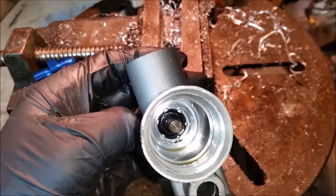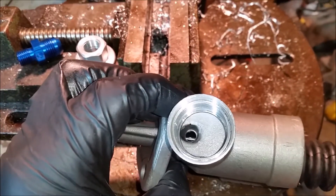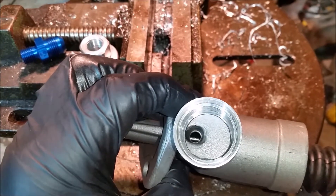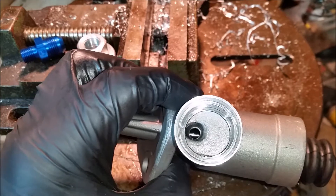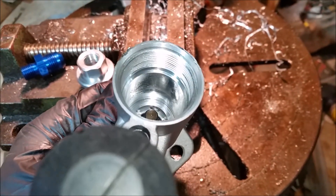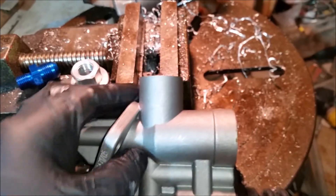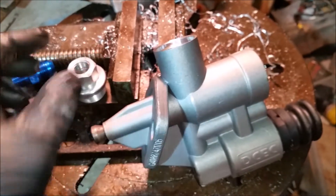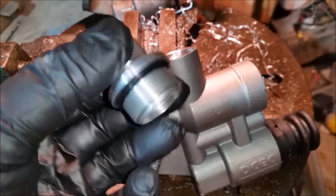It's very close to the lip that holds all the guts — the plunger and everything on this side. We analyzed that and realized we can't really go larger in diameter. We can take off those casting flaws, but what you can do is go laterally, so we're going to open that passage up just a little bit laterally to try to encourage some flow.